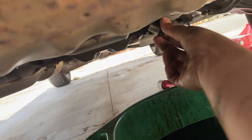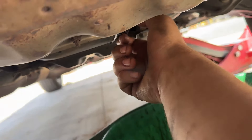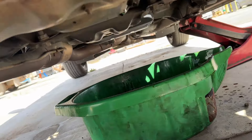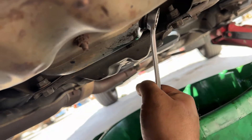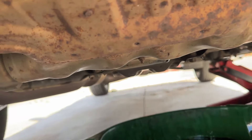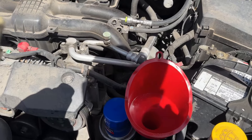Filter's done. Oil is just about drained. Go ahead and toss our bolt back in, clean up whatever drips were made, and then tighten our drain bolt. Now we'll hop up top and fill her up. Drain bolt's tight, new filter is tight.